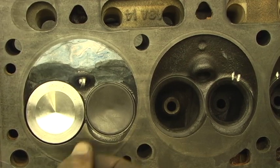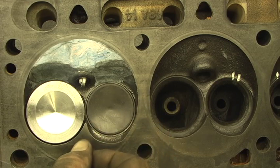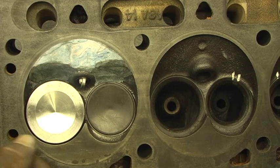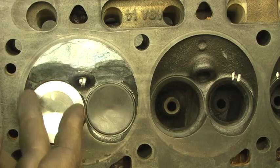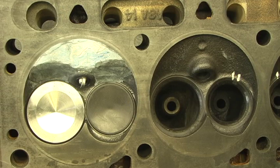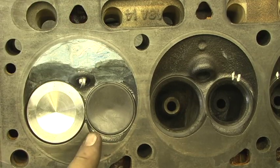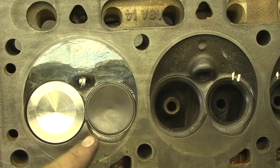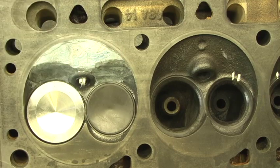I've got to go in here and slice and cut this whole section back. You can see the gasket line where I go in here and cut all that out and unshroud that. I am putting material in it, but I'm going to be carving a serious amount out here and here and all this chamber shape, which is going to really make a difference in it.